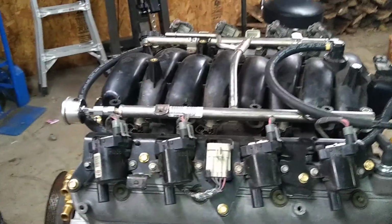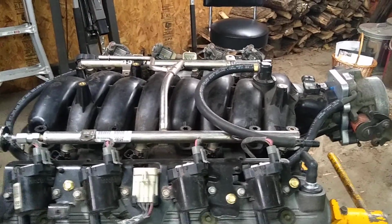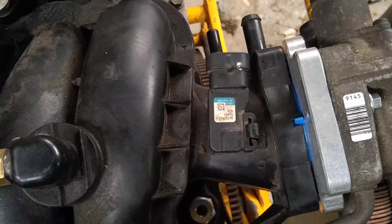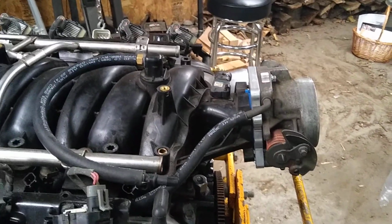The intake, I mean, I said if I found a good deal on a car intake, I'd buy it, and this was a good deal. It's a piece of junk intake. This is an LS4 front wheel drive intake. This is like the worst intake for an LS motor. It's awful. It's made to be on the engine backwards like this, and you can see they have a relief here in the throttle opening. They notch the intake in order to clear the oil sender on these things. So it necks the opening way down to, like, I don't know, 50 millimeter or something. So it's restrictive. It's terrible.